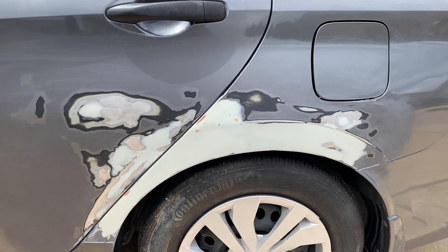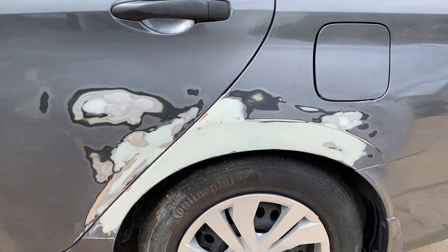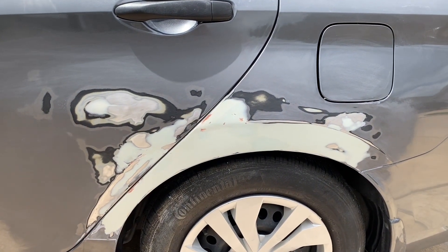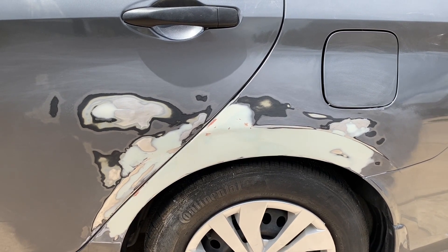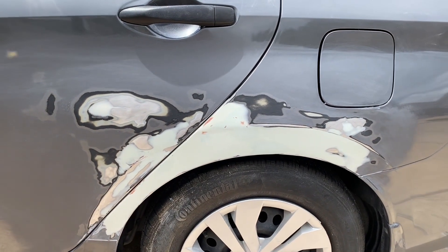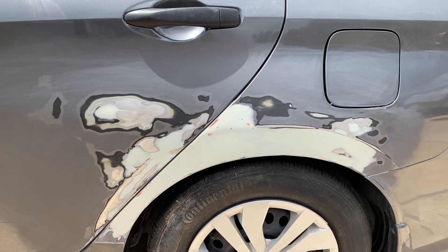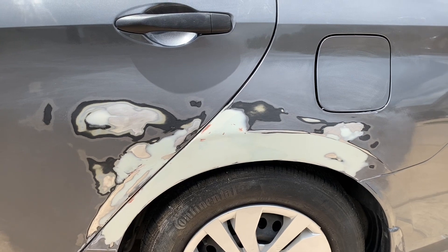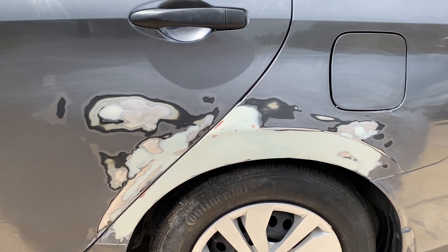So I used the Rust-Oleum primer and Rust-Oleum sealer. I had to sand this thing down with 600 grit and remove all that old primer and old sealer because they said to get the good primer. They talked me into the SprayMax 2K filler primer. I'm going to use that and do a video on it. Then I'll block sand it, wet sand it, and get ready for paint the next weekend. I actually got matching paint this time from a place that mixes it, so it should blend a little better. I also have the 2K clear to add to this.